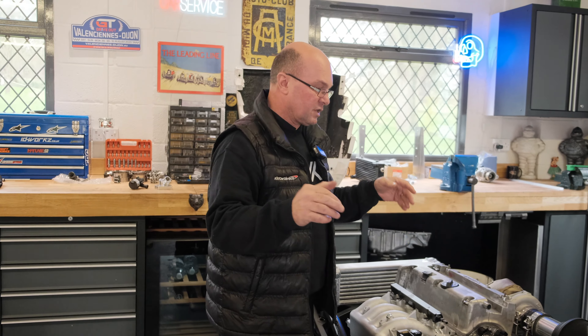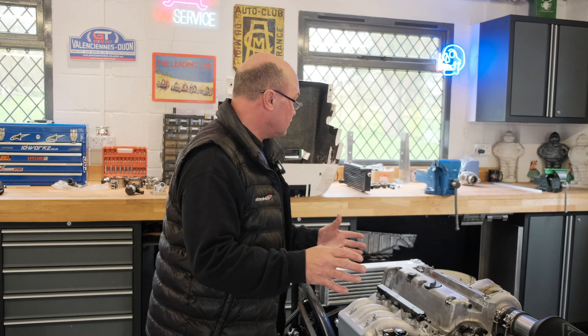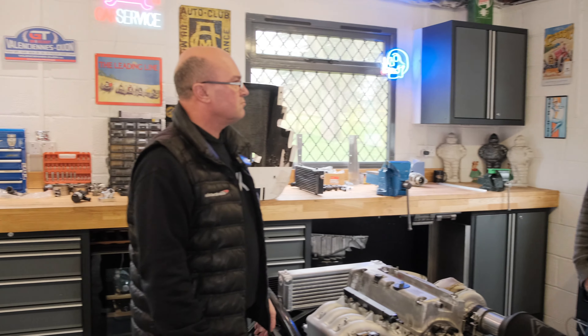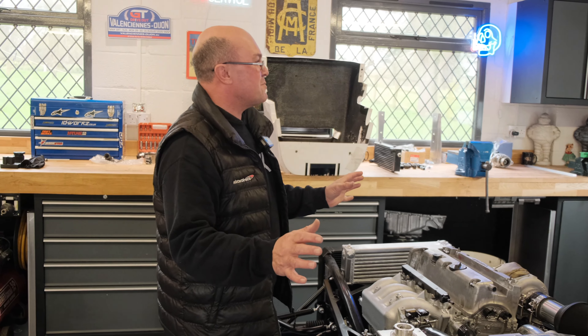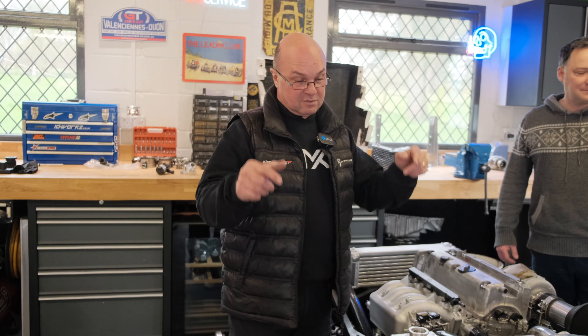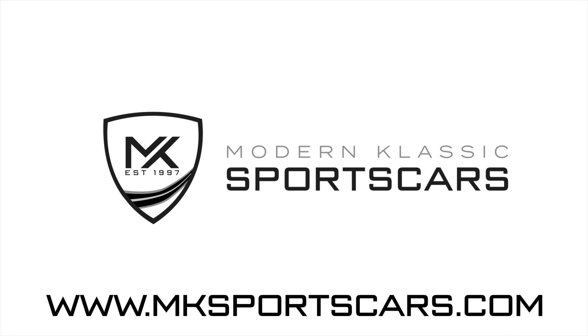On the engine case here we do a water pump - the water pump's going to be sited down here, and we have a laser-cut plate that goes in here with the take-off for the inlet, and the hot water coming out of the top at the back. There are some breather mods for the rocker cover still undecided. That's the housing for it - it's a nice bit of kit, you can swivel it and put it wherever you want, with a couple of take-offs for temperature sensors. That will go down here and fix up to the water pump. For the charge cooler, these are the fittings that are going to be coming out, and we'll have a little Bosch water pump - a 19mm outlet/inlet - that'll be more than sufficient to run this system and keep the charge cooler going.